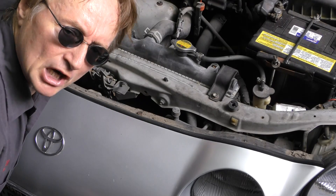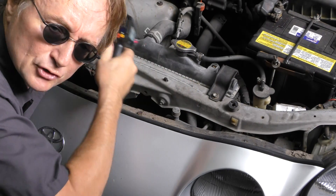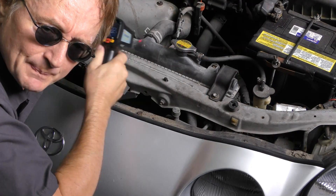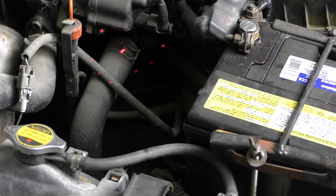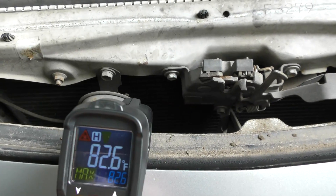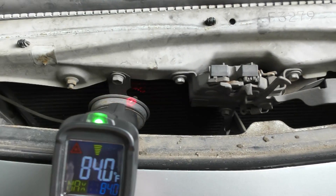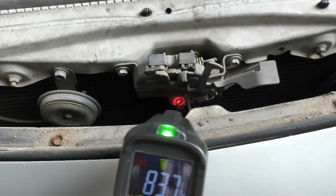The uses of these guns are pretty much only limited by your imagination. Maybe your car's overheating — you can check for hot spots using the gauge. Maybe you think your thermostat's sticking; well, take the temperature before and after the thermostat. That way you don't have to take anything apart — it's a non-contact thermometer. Maybe your AC isn't running right; you can check for a clogged condenser. Take temperature readings, and if some parts are hot and some are cold, you know it's clogged up inside.